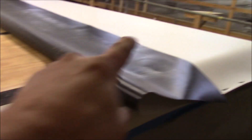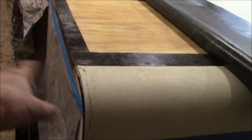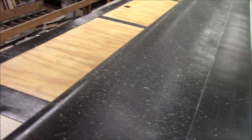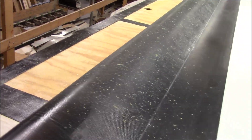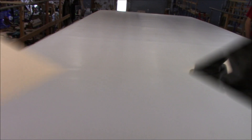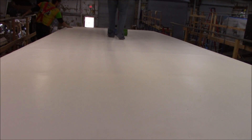We've got our passenger side already done — all glued, protective strips in there, everything done. Now all we're doing is rolling the roof out. We're going to get the big roller on here, pack her down. Now we get the big heavy roller — we're going to put that over here and pack her down. That's how you get a good bond.